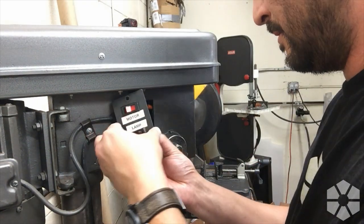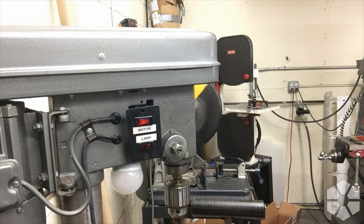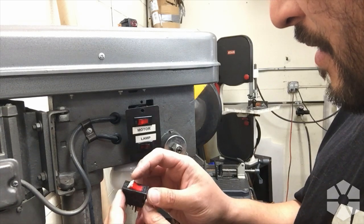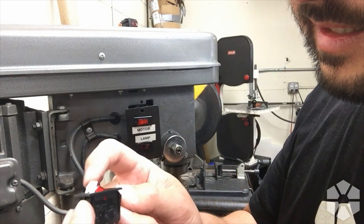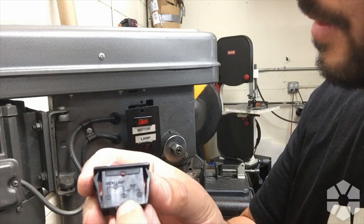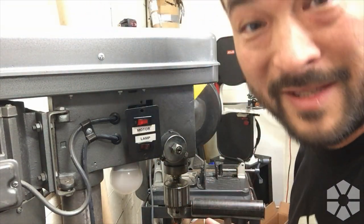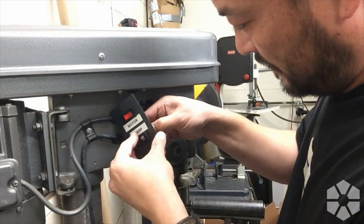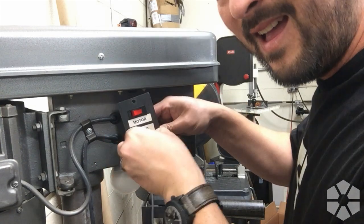I'm a little confused about why the other isn't lighting. Is it not an illuminated switch? This is the one I dropped on the floor — it does say 'lamp.' It also seems to indicate there would be three poles, so I think this is actually not illuminated, and now that I look at it I don't see any light in there. You can see on the little wiring diagram how the lamp should be on legs one and two, which matches my new switches. So I guess this just was not a lighted switch in the first place, meaning I don't have to fix the light on either switch. I pretty much feel like anytime you've got a 50/50 choice about doing something the right way or the wrong way, I do it the wrong way.